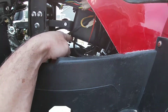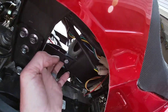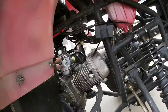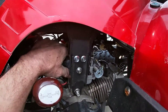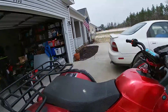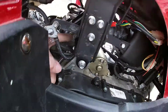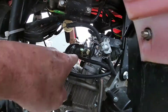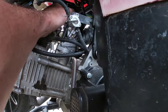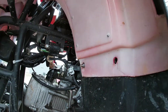Then you've got the ones that go into the air box — got this one right here to here, and then you've got this one up front that goes all the way up into there. So let's go over everything again: gas line in here, leaving all the factory settings, got that in there, used flex seal, got that on, screwed that on. This hose — remember if you have a valve right here, you're going to put it on the valve, otherwise this is your gas shut off valve and that goes right there. This hose goes from here to down here, got your drain line, and that one is just left open to air if you don't have a vacuum valve. So I've just got it tucked in there.